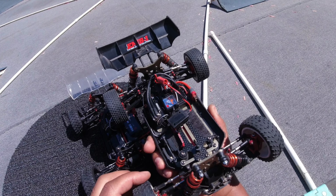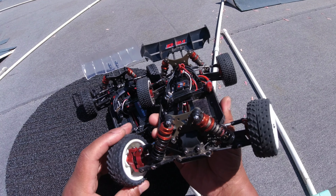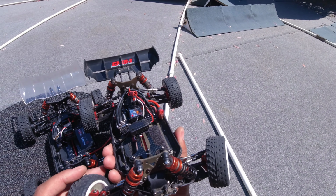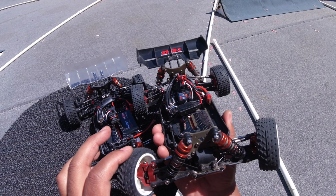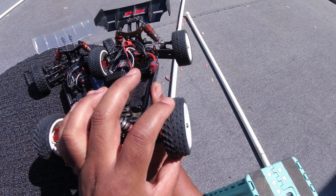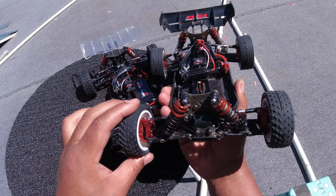So we have the factory LC pop-up parts on the hubs, aluminum, which definitely gives it more durability and less breaking point. On the hubs, they're not going to break. It has a little bit of wiggle to it also. That's actually the bearing, but yeah, that's where it should be. So this bearing is probably toast. Should probably switch that one out.